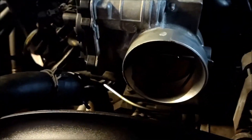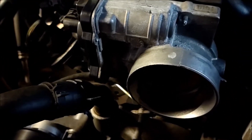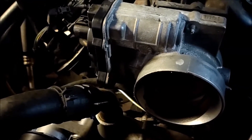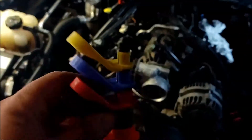I unbolted these three bolts here — this is loose but it won't come off. Kind of hoping I don't have to take the coolant lines off of it; they really have no way to clamp them. I was hoping I could just slide that off — I bought a new gasket for it. I got the gas line disconnected and put a rag here because it's dripping gas. I found some tips on YouTube on buying these nice little quick disconnect couplers — that worked good.